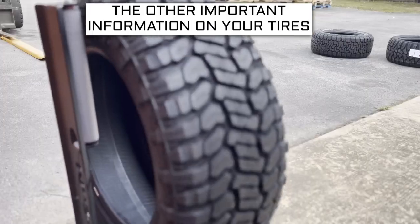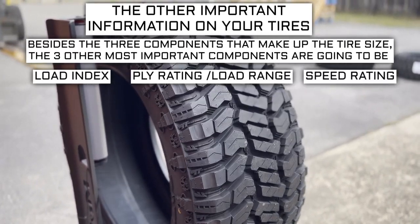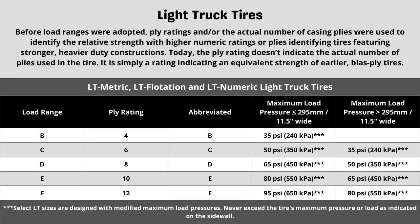Now let's get into the other important info on a tire. Besides the three components that make up the tire size, the three other most important components are the load index, speed rating, and ply rating or load range. These three components will sometimes require additional research to know what your vehicle needs. These tires have a 10-ply construction, and each designation represents a different term when looking at a tire. This can directly affect things like max tire pressure. When in doubt of the rating your vehicle requires, in most cases it is safe to go with the same rating your vehicle currently has, as long as it was replaced with the correct spec last time.